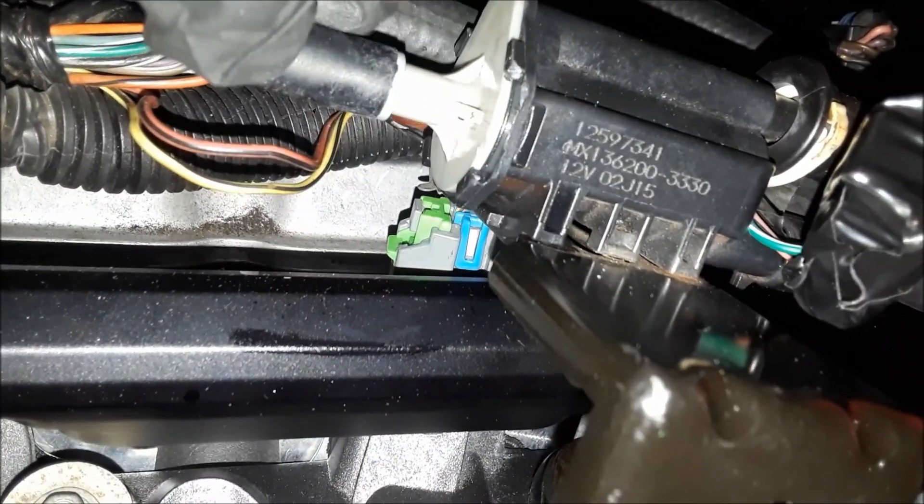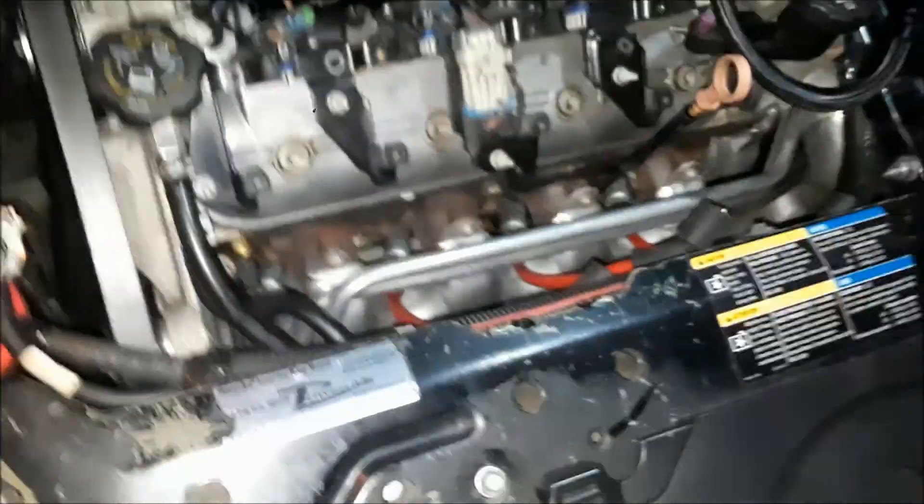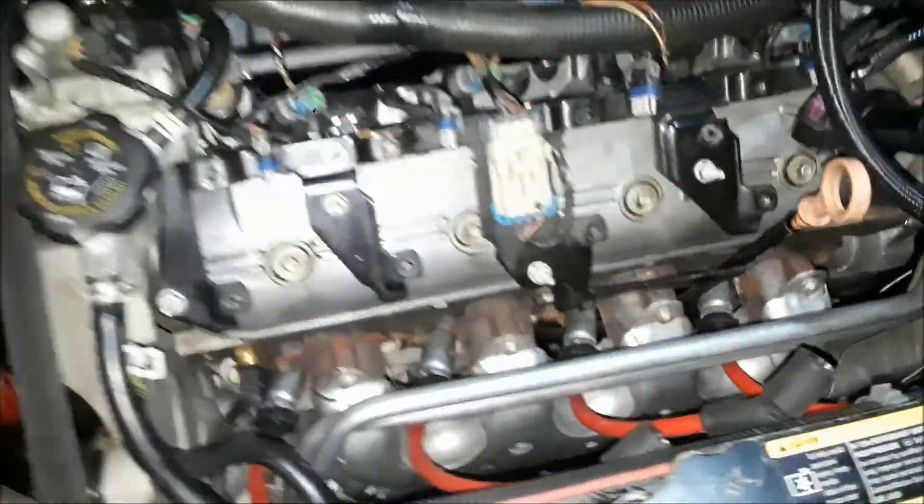Quick update on the next chapter for the evap: I'm capping that off. I can probably even put a little clamp to it to make sure it stays in place, but it shouldn't go anywhere. I'm going to also cap this off due to the LS3 that I'm putting on. I currently have the coil packs off — she's awaiting her ZZP coil packs. And I know some people might say you didn't have to do that or it's unnecessary, and it's looking like I'm getting a little leakage right here.